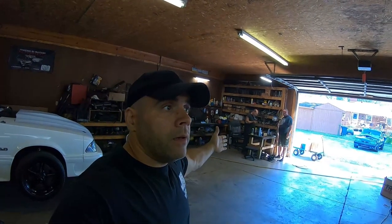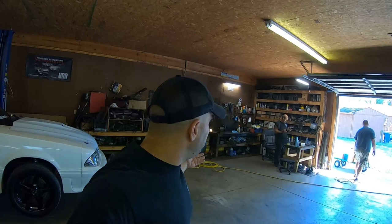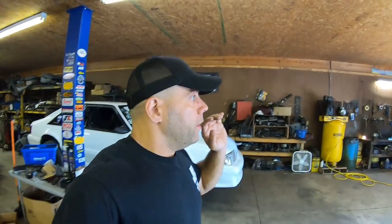So like I cut a 1.29 60 foot and ran a 9.40 at 149 in this car. Whereas Cousin Paul last week ran a 11.72. Yeah. But he had like a 1.54 60? Yeah. Now see, we know that car because it makes 330 wheel horsepower, but it makes like 480 torque. We know that car in the suspension that it's with can cut a 1.45 absolute best 60 foot. So you see what I'm talking about. A lot of your 60 foot depends on how you stick the car, how good the suspension's working on the car, and how much power it makes.